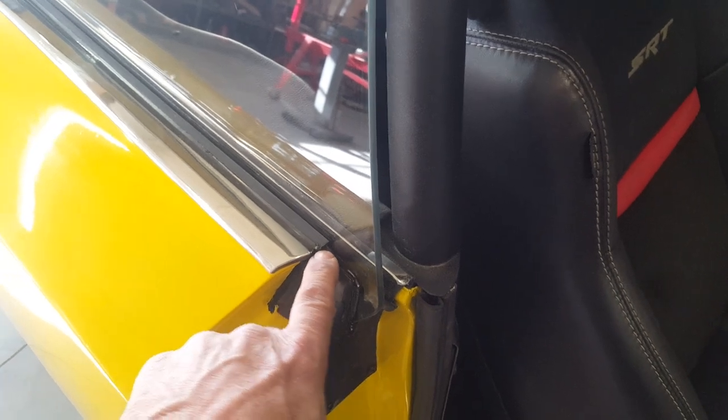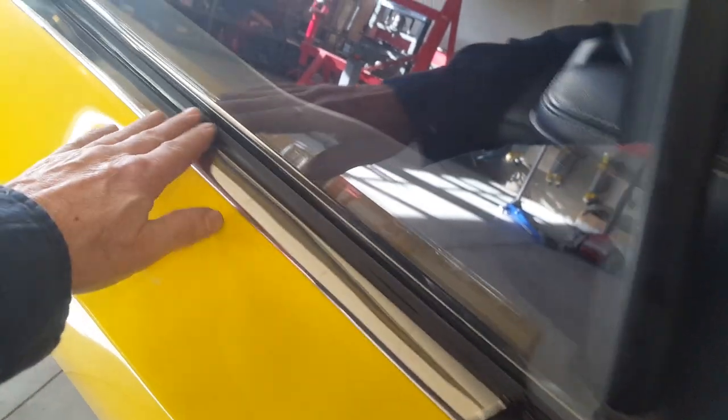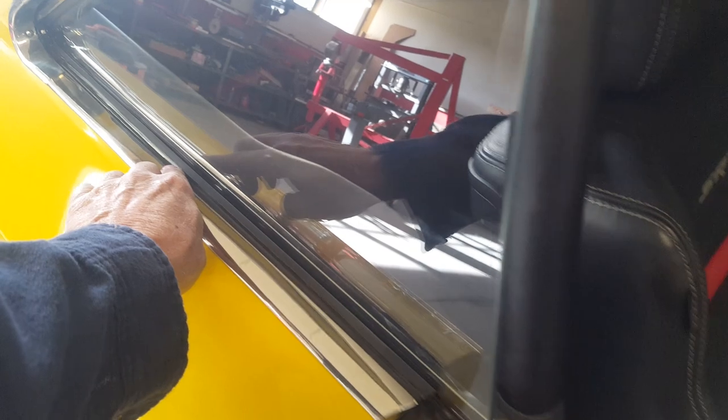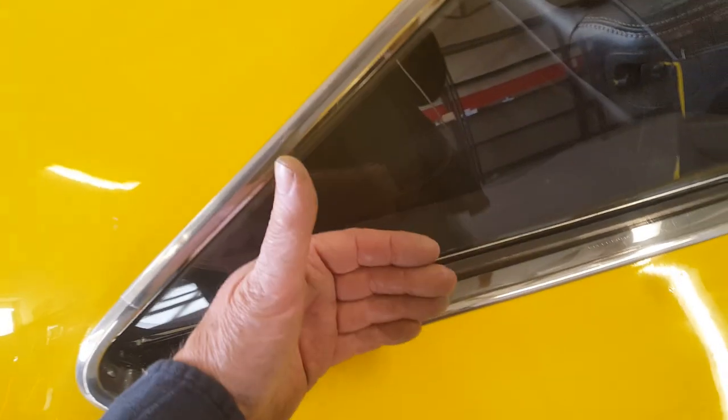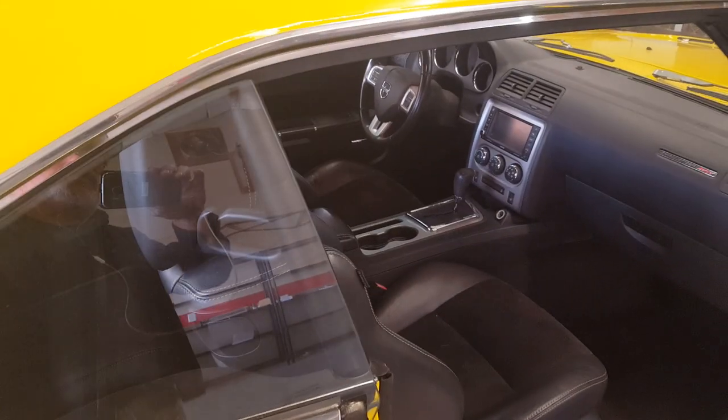The console and seats look good. Because these are stationary windows, I did work inside to create a pocket so any water ingress would drain out. In addition to the window whisker molding that holds the window in place, I added another rubber molding pushed down against the glass to catch the inside edge. Then I taped off and applied a narrow bead of windshield urethane to glue it to the stainless steel tracking, sealing it against the window. Any water sheds off at that point, and if anything gets by, there's an inner track and drain through the door. This car probably won't see many torrential downpours, but summer thunderstorms can catch you at a car show.